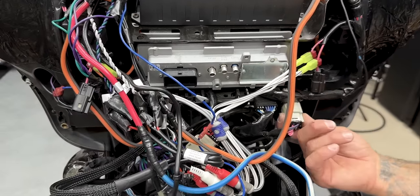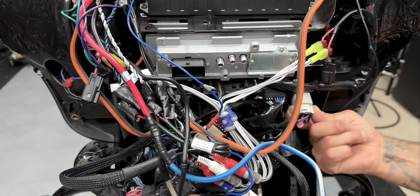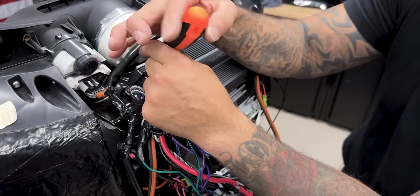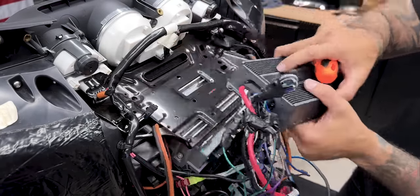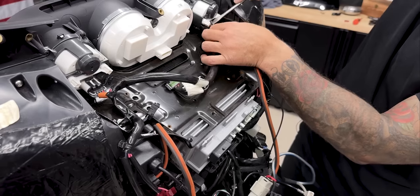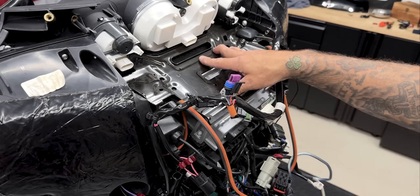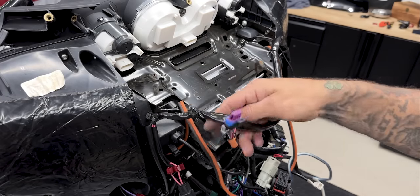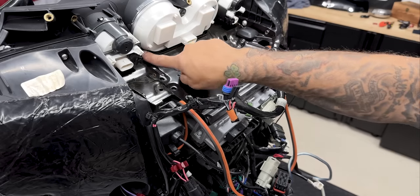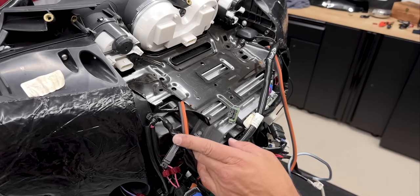We're disconnecting the left and right main-to-fairing harness — just disconnect these two harnesses. You can't mix these up: gray to gray, black to black. The two speaker wires are running through the support bracket, so I have to pull that off. To remove the upper support bracket, you have a total of 11 screws — four screws mounting it to the radio (these are missing because the amp was installed), two more up top, and two on the sides mounting it to the speaker enclosures, usually T25. Then one more screw right here.